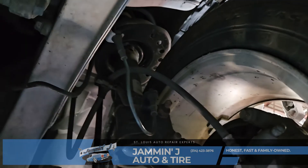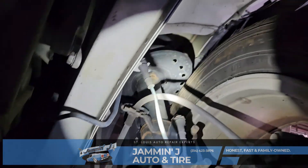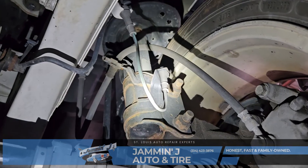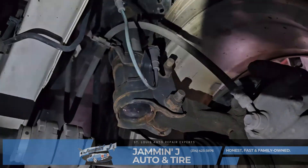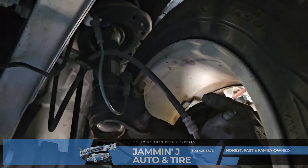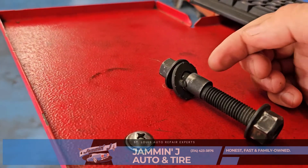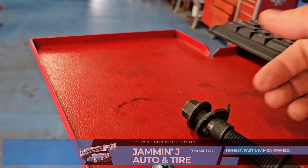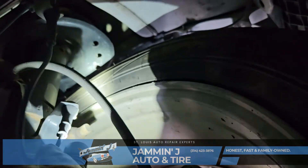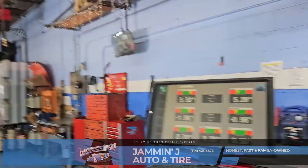The second angle is camber. If you look up in here, what you're seeing is a strut — the long cartridge with the spring around it. When they put this car together, camber is set from the factory and you can't do anything about it. Camber is the tilting of the top of the tire in or out. However, on a lot of these cars — including this one — we can adjust camber a little bit using what's called a camber bolt. It's a special bolt with a little hump on it and a special washer. We take out one of the top bolts and replace it with that bolt, which gives us a little camber adjustment. This car probably won't need one.